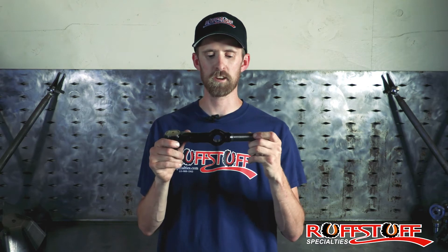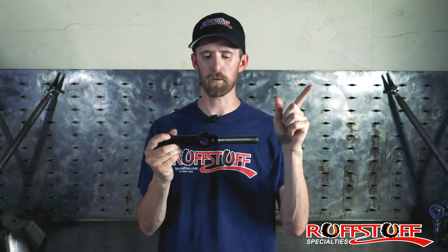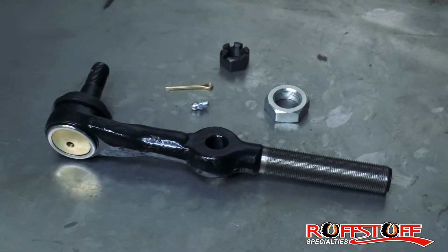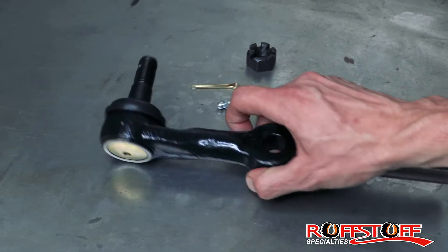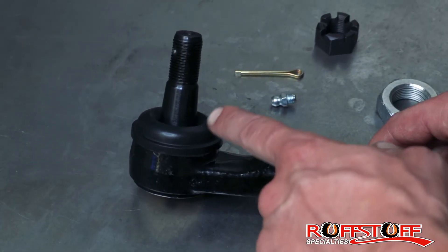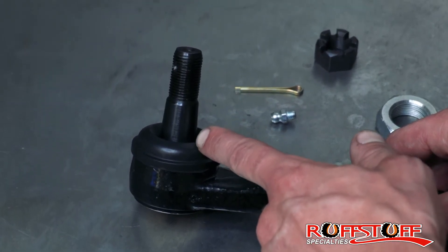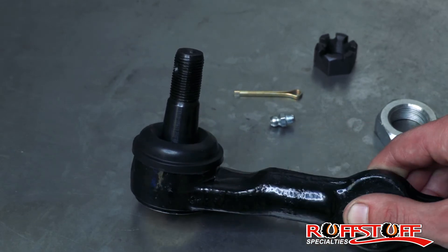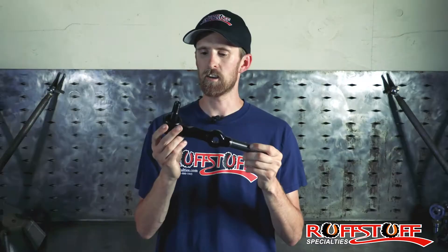You're going to see it's tapered here in the middle where your drag link running from the pitman arm is going to connect here rather than to a knuckle. The taper on this is for a GM one-ton standard rod end, not the high angle. The taper is going to be the same as our standard one-ton: a half inch for every foot. The large end is going to be three-quarters of an inch, the small end being about 0.68, and also 20 degrees of travel on that one as well.